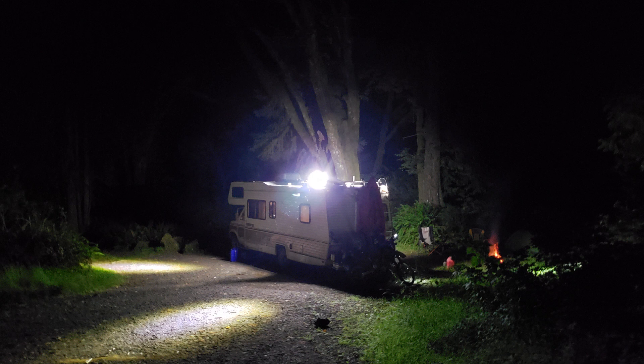Pretty simple upgrade overall. The lights are super inexpensive — I can't believe how much light you get for that little cash. The ones on my Jeep roof rack have been completely exposed to the elements — snow, rain, sun — for two years, and the ones on the RV have been on about seven months, all working flawlessly. One thing to mention: these will attract bugs if you're in a buggy area since they put out a bright white light. Also, they're so bright you're probably not going to want to use them in RV parks — this is mainly for boondocking — and you cannot use them while driving as you'll blind oncoming traffic.